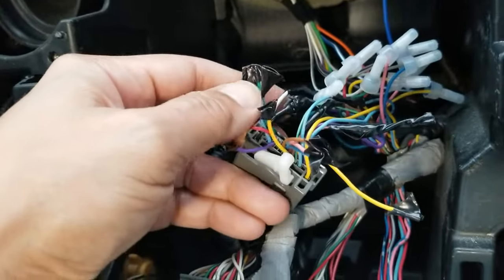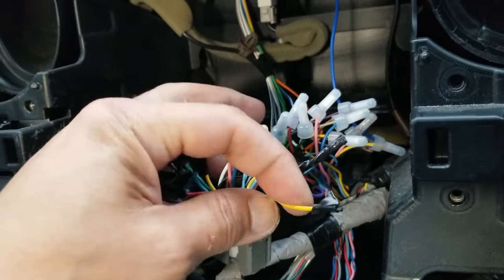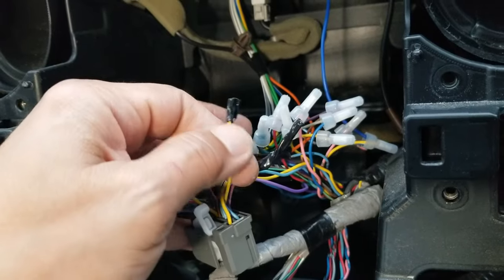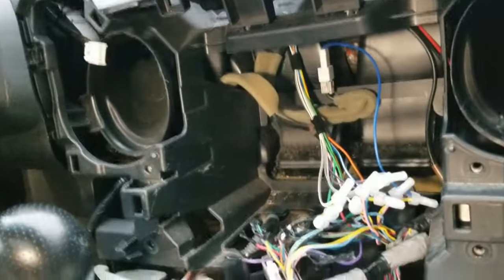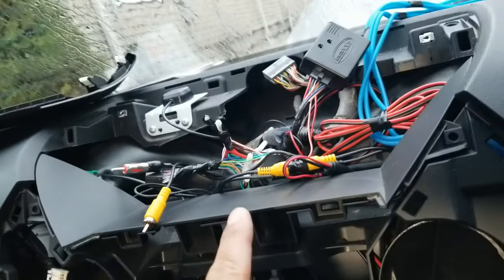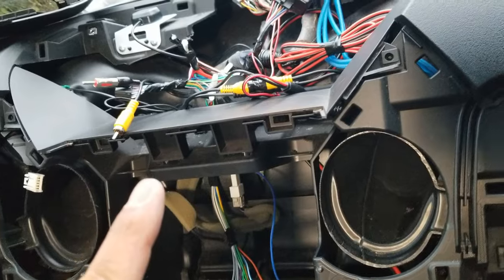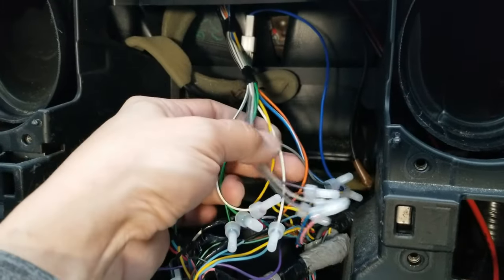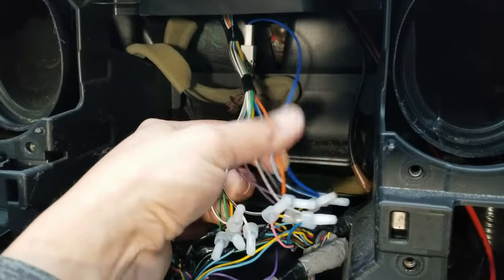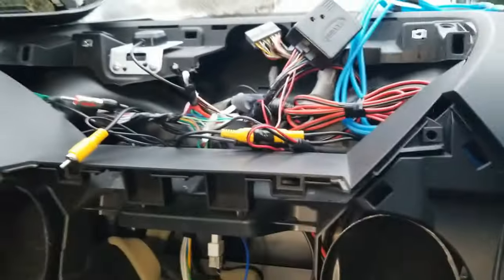We'll do it this angle. I cut them away from the radio. Just tape them off. I didn't want to waste more plastic. Do we even really need to waste more plastic? So, capped it all off. This power amplifier. That's right. Amp turn on. Okay. Cut that. I made it come off of this one. I want this radio to be my amp turn on, not this radio. Because if this radio feeds audio, if this is powered up, there could be a timing issue and it'll pop. We don't want that. So we want the main unit to be the one to give us power and audio at the same time. So these all are. Speakers, I cut them away, spliced them in together. My illumination, so this can dim. My battery, so this can keep memory. And now we're going to start putting this guy back together and see what we look like. So let's go.